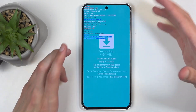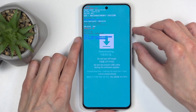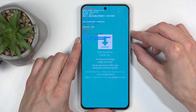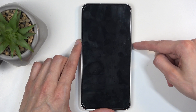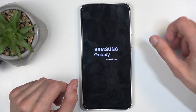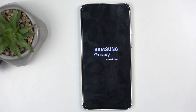To leave this mode without doing anything, you would just hold your power button and volume down for more than 7 seconds, which initiates a reboot of the device. Once the screen disappears, you can let go of the buttons — it looks like it turned on automatically on its own. When you hold them, it will reboot the device and then start booting back up into Android.